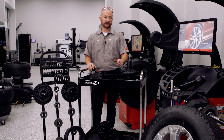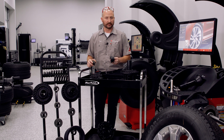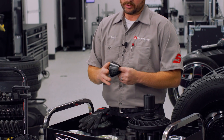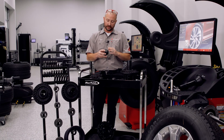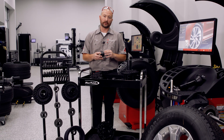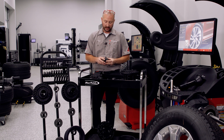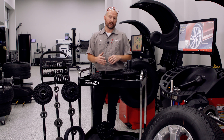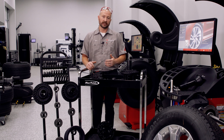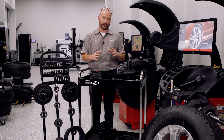The best way to duplicate the mounting process of the assembly on the vehicle is to make sure we're identifying whether it's hub-centric, lug-centric, or if it's okay to use a cone - such as maybe a steel wheel, trailer tire, spare tire, something of that sort. Steel cones have a very high taper, and that's okay on a steel wheel because they're broached, so those two angles can mesh and ramp slowly. But that high taper leads to a very slow ramp-up speed, which is not ideal for an alloy wheel, hub-centric design, HD truck, or three-quarter ton truck that's very heavy with a short ramp-up time.